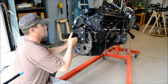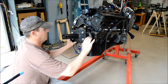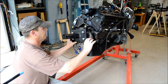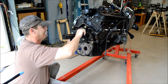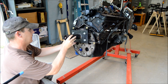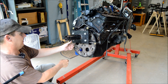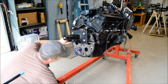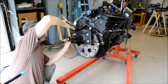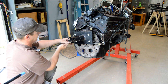So now it's time to adjust this thing where we want it. Here's the center of the crankshaft and you can see I'm several inches above that. So what we're going to do is try to snug one up here, a couple of them, so that it'll hold there. I'm just kind of eyeballing it to the flat plane here of the top of the intake where the intake manifold sits on the top of the block. That looks pretty darn good. I'm going to snug these outside ones up. Make sure the washers are clear — the reason why is because you'll ruin your washer and you run the chance of the thing clunking down, slipping, scaring you, and possibly breaking a bolt.